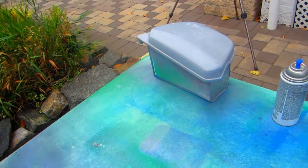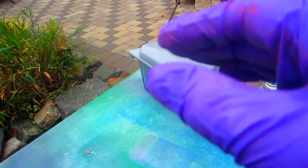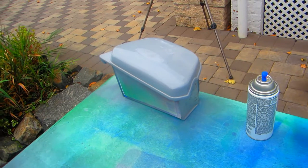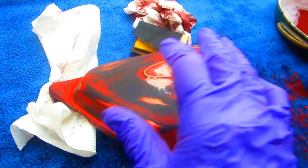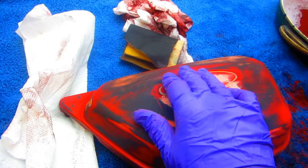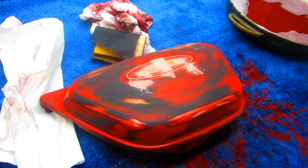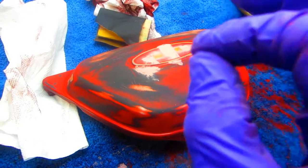I just want to mention: there are times that you put the second or third coat on and somewhere in that mix you wind up having a problem, but maybe this is going to be our lucky day. We always just try to stack the deck in our favor. Now, while one part is drying, this second part is ready — I'm going to do the same machine sanding, then final hand sand it, take it outside, repeat the process, prime it, and hopefully that's going to dry well. Whenever you're painting plastic there's always a chance there's going to be a real problem.